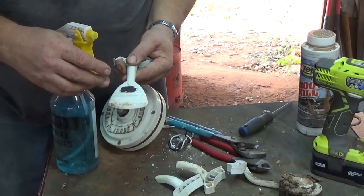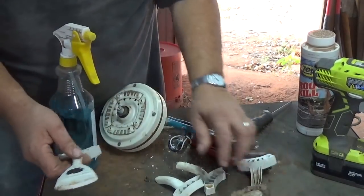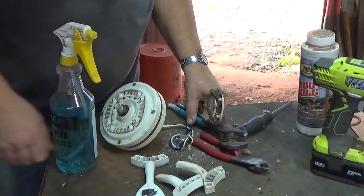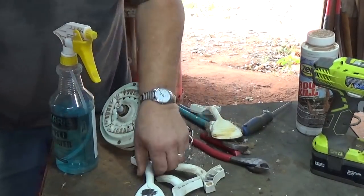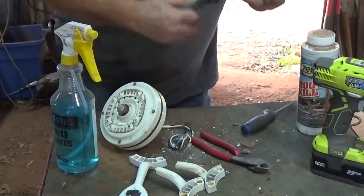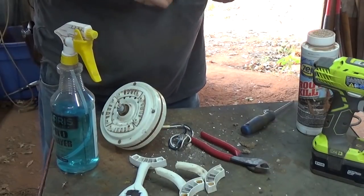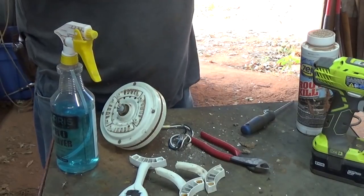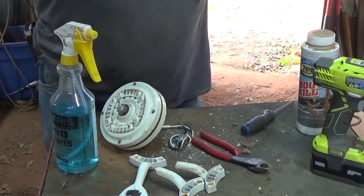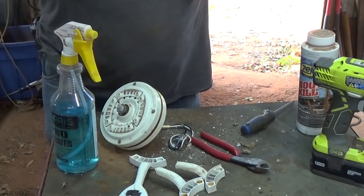And then if you see a bunch of little bubbles, magnesium. Don't throw it in the fire. So since that got dark, it's die cast. I've got, what did I do with it? I got a piece of magnesium I found the other day.